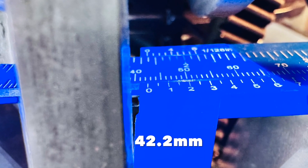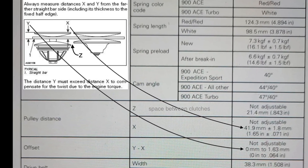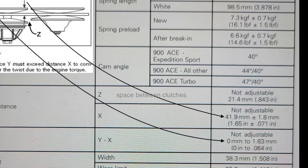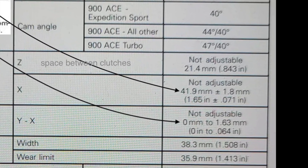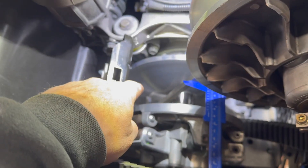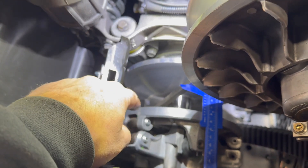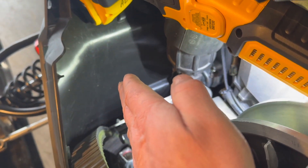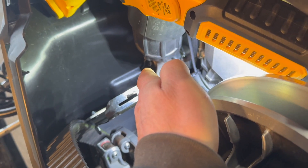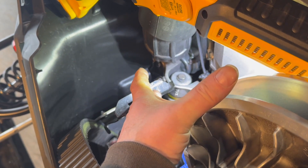Now we're going to concentrate on the Y location. That's the front of the P drive or the bottom. You can see on the diagram from BRP it's not adjustable, but it says anywhere from zero millimeters to 1.63 millimeters. I find that a little interesting because these engines really move a lot, and if it's set at zero, that thing is going to be out of alignment once you're under load.